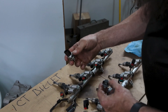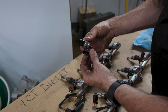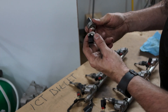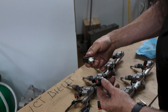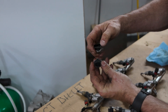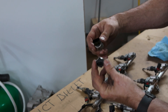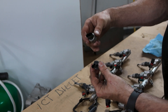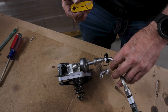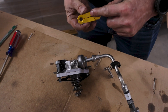The difference on the fuel rail pressure sensors is the new one is a lot smaller — it's 3-pin. The old one is bigger and has 4-pin. They both have the same thread, so this sensor is interchangeable on the rails. The connector is a lot bigger on the old one — 4-pin versus the new 3-pin. This is the L84 and this is the LT1 out of a 2016. We're going to remove the fuel pressure line — this is the inlet to the high pressure pump — using a 3/8 tool.